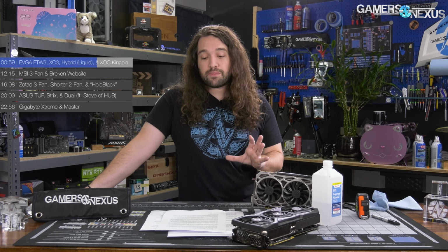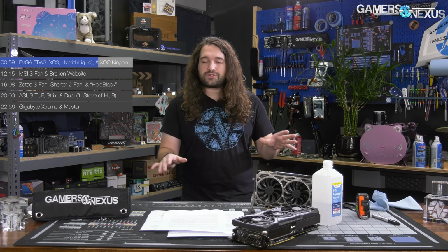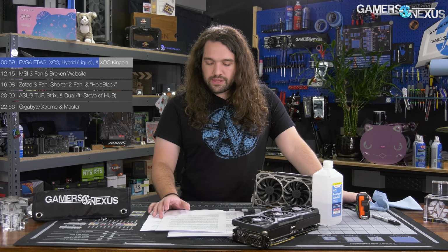We've demonstrated this in the past by testing with and without that type of cold plate and cooling the memory separately. Generally speaking, temperature goes up a little bit when you do that for the GPU, but the overall temperature of everything goes down. So typically worth it, but don't be surprised if it looks like the GPU is a couple degrees warmer than maybe a competitor if the memory modules are not measured between them.